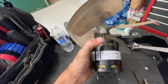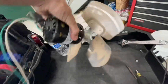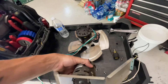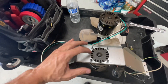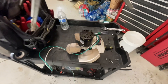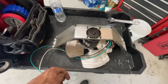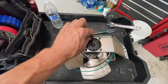To switch the fan blade, it's just that one little bolt that holds it in place. Now we're going to flip this over. All you're going to do is take out these four nuts. This bracket will sit right on top of there, then we'll put the nuts on and we'll be ready to put it back inside the machine. Bracket is off. The old fan motor bracket goes on our replacement fan motor just like that, and then we're going to replace these four nuts.